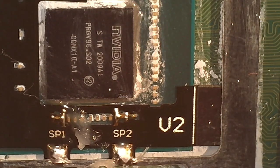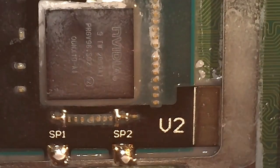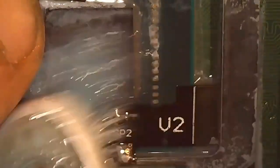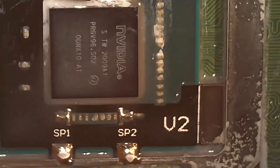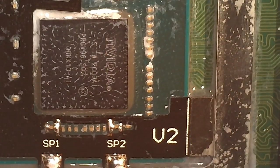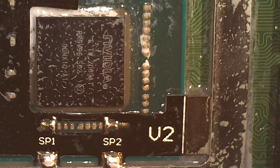You never, ever, just don't use soldering wick on these. Almost 100% of the emails I get from people asking me for help because they messed up their installs are because somebody tried desoldering one of these, typically with desoldering wick. Just don't go doing that. If you bridged two points together, you don't need to wick it. You can easily just flow it off, as I'll show you very soon here.